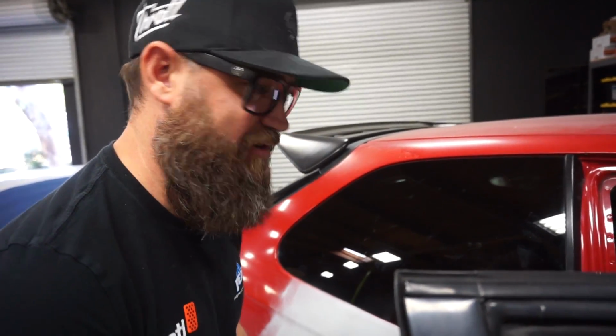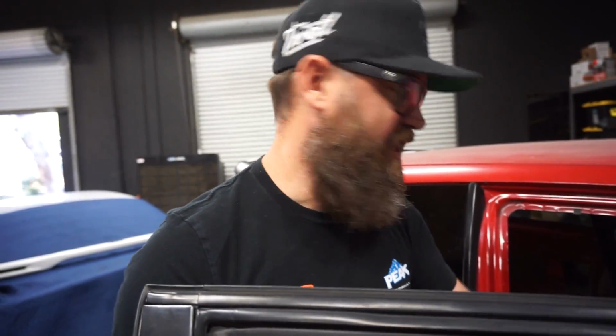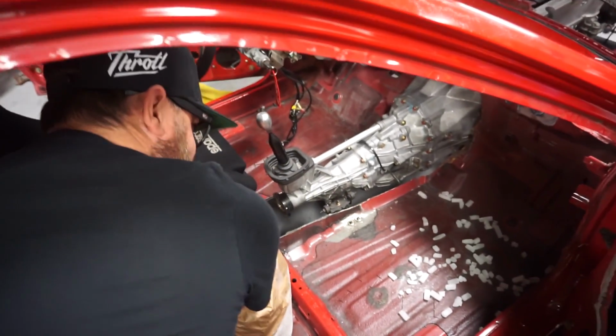The less hitting the floor pan with a hammer, the better in my eyes, because I don't want to dent the floor pan. So get everything out of the car. I'm going to spread this out on the passenger side and get it started. Then I'll pull the driver's seat out, and hopefully we'll be able to just chip this up. The idea is to freeze the tar, and then you can take it up in big chunks instead of scraping it with a scraper. That's cool.